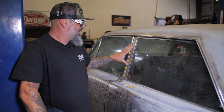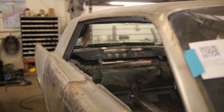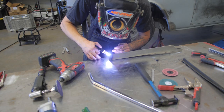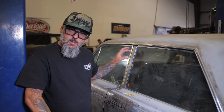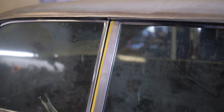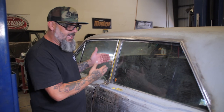B-pillar delete. This is the most wanted thing in these Lincolns because when you roll the windows down, it makes a nice open, vert-style window. What we did here is we actually built these out of sheet metal. Peter formed them all and made them all so they're bolt-on. What we're really going to do though is make an extrusion — actually made out of aluminum. Extrusion is basically a die that aluminum gets pressed through and comes out a certain shape. We'll show you more of this when it's finished, but you can kind of get the idea of where we're going.